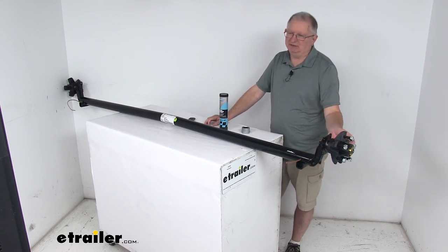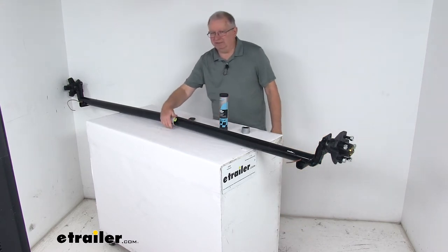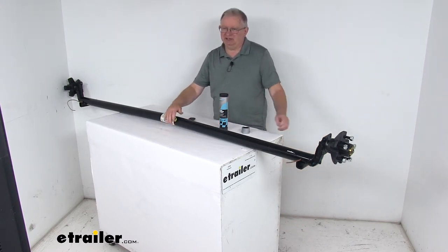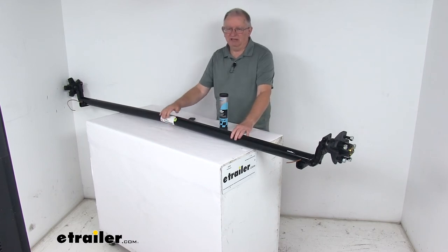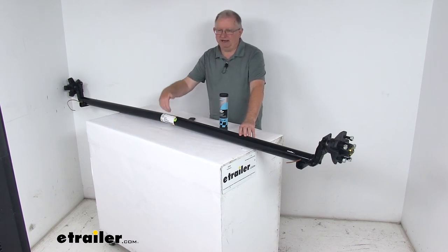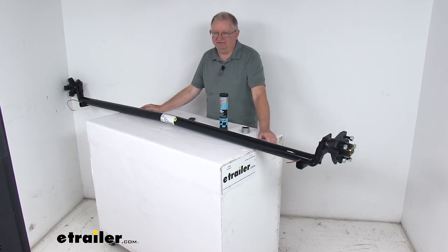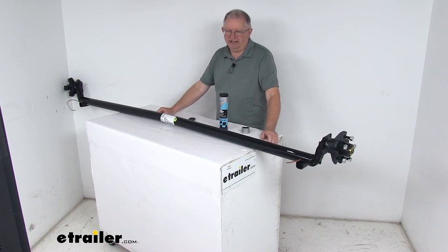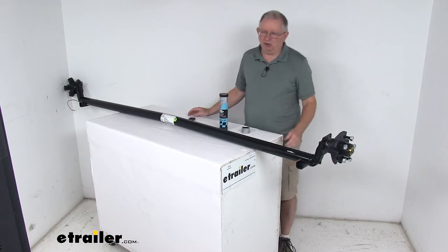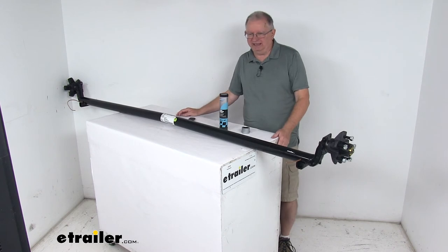The spring seats and the spindles are all welded on. Also on this axle, you might notice right in the middle here, this has a bend to it. This is to ensure the proper camber angle. When you install this axle, that bend should face up and this label here should face the rear of the trailer. Having the center a bit higher and the sides of the axle bent lower allows the axle to compensate for the load on your trailer. This bend creates a nice zero camber angle for even road tread contact across the width of your trailer tires, ensuring the angle of the wheels is correct for your towing needs.